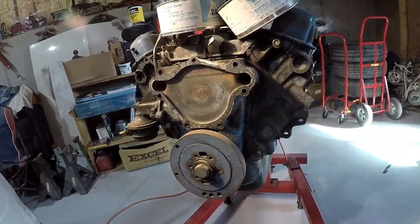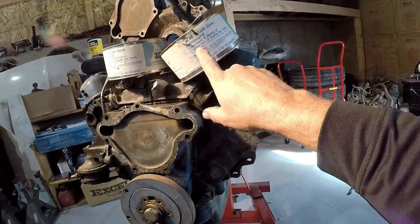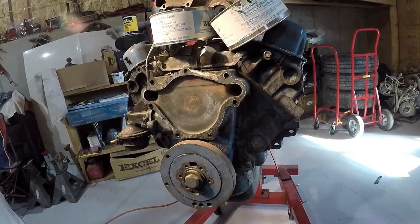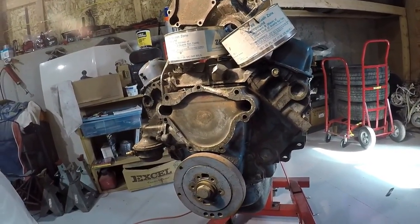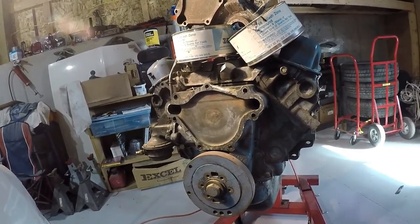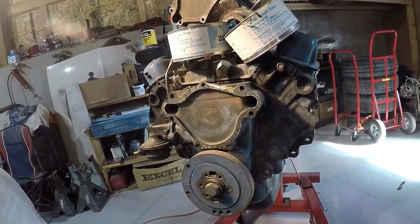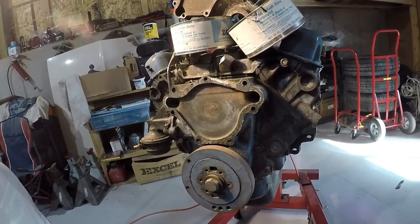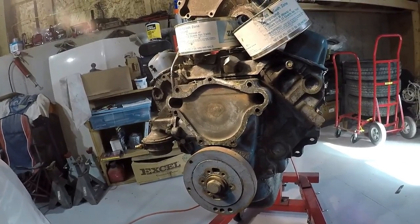And now I'm going to show you how to prep it and get it ready so that this stuff never comes out of here. A side note, this stuff is what professional porters use when they have to fix an imperfection or they ground too far in a spot on the intake side of a port. If it holds up to that kind of abuse, it'll hold up to this. They don't use it on the exhaust, it wouldn't hold, it would burn right up on the exhaust port. But intake ports, it's a commonly used material, and it will hold up wonderfully on this.